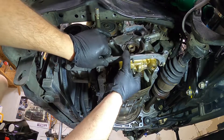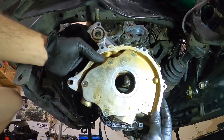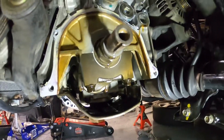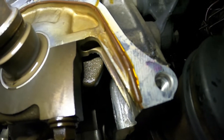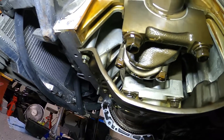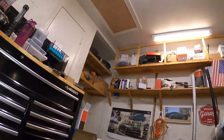I just had to hit it with a brass hammer a few times. I have taken off the OEM original oil pump from 1994 with 152,000 miles on it. There's the old O-ring right there. Looking at the block, you can see what looks like a brown bead of RTV around there — that's where the O-ring rests right in that hole. You can also see the bottom of the rods and the crank in there — it's nice and clean, no sludge at all.